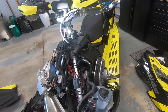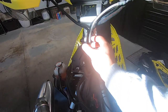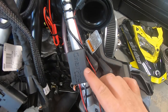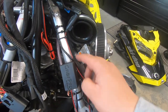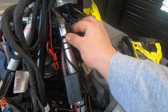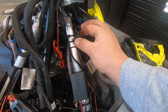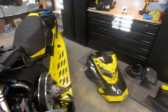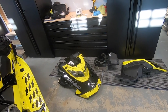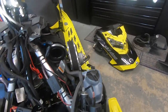We just finished wiring in the NARPRO. The cord comes through here, tied down with all the other wires, and the NARPRO base unit is zip tied in here as well, all wires nicely tidied up. This is the plug-and-play adapter that's going to plug into your accessory plug. Our accessory plug is underneath the hood because of the e-link, so when I slide the hood back on I'll hook that in and the NARPRO will have power.